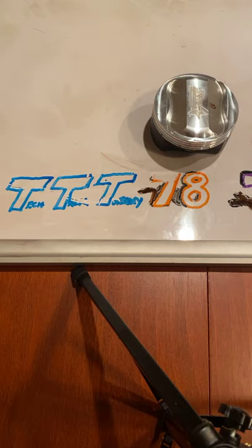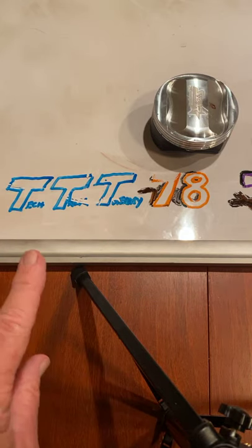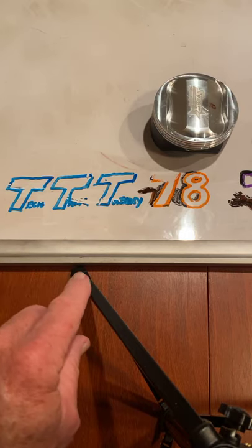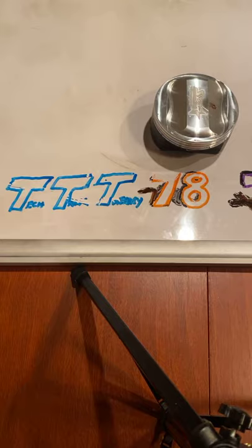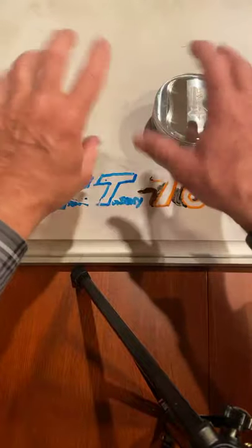People say if you put a smaller one on the front and a bigger chain tensioner, or you put a bigger clutch gear on, or whatever you're doing to take up the slack, if you put a smaller compensator sprocket on the front, they say it gives you more acceleration. It does not. It changes the gearing overall. Same thing you do if you change the rear pulley, the front pulley, or the sprockets on the chain in the back. But if you change the rear pulley or the rear chain sprockets, you don't change the clutch to engine relationship. That's what's important.